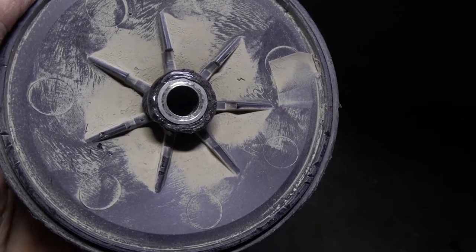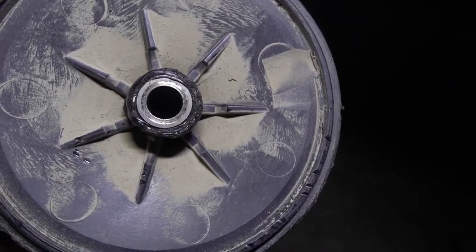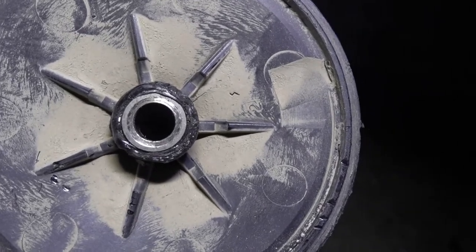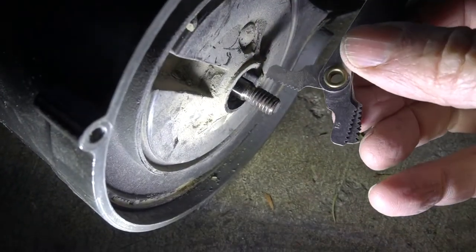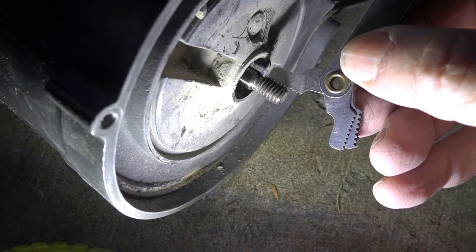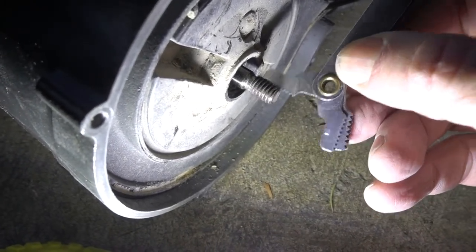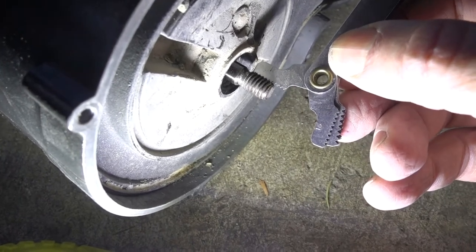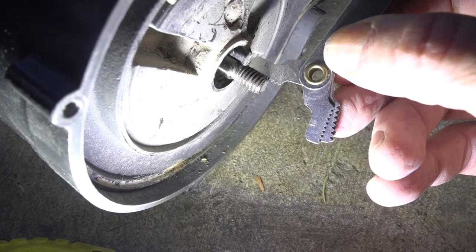I might be able to get a nut. If I could pop out this threaded insert and epoxy a nut in there that'll fit the threads, I might be okay in that regard. My thread pitch gauge tells me I'm gonna need an 18 pitch nut for that. I think it's 18 threads to the inch. Anyway, 18 matches it perfectly. Gotta find the right diameter.